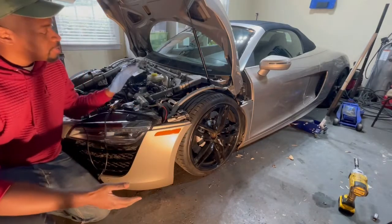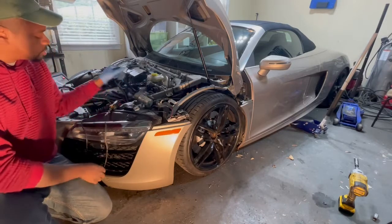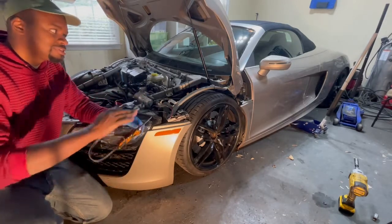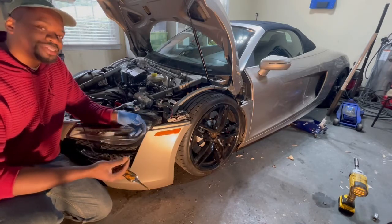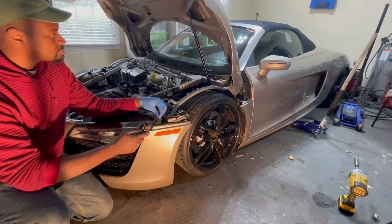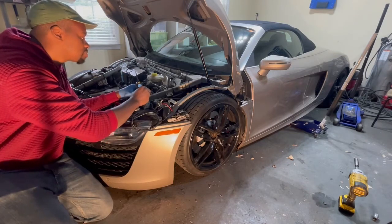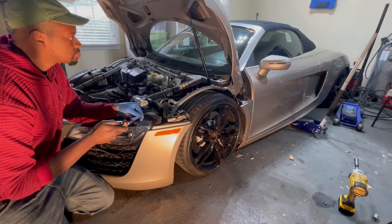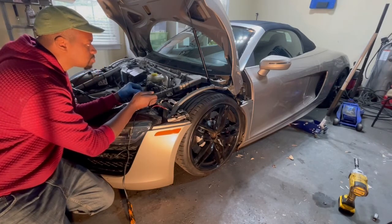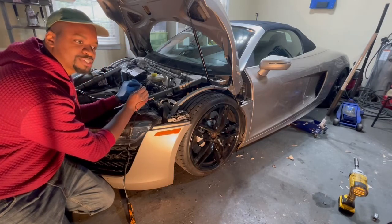The replacement shock is installed. I have the line coming out to my Via-Air air compressor and my power and ground leads right here. I'm using my Power Probe to apply power and ground to it just to see if the suspension is going to raise without struggle — it's pretty much empty right now so it'll take a moment. I'm hearing some air leaking — I'm not going to bolt it down but it's just going to rattle for a bit. It's still leaking right around here, so I'm going to cut this to get to a fresh point and try again.